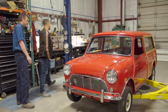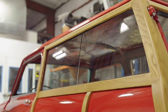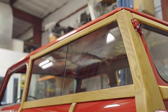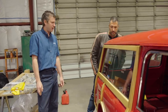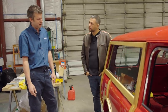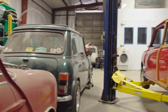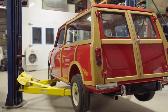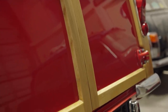And now the wood — tell me about all of this wood. The wood turned out beautiful. Being the control freak I am, I even had my father come in and make the wood kit from scratch, replicating the original kit that would have come on this car. It's American white ash — correct for the car, though originally it was probably European white ash when they made it. It's finished just like a wood boat: if that finish lasts on the bottom of a wood boat in the water, it should last on a car under a car cover.